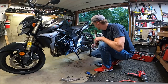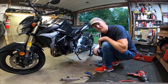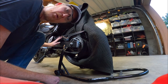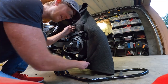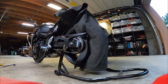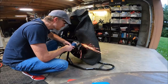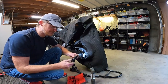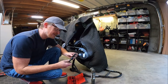If I understand, this is where I grind a pin and push the pins out to remove the chain. Once the chain's off, we can slide this sprocket off. Before I start with the grinder, I'm going to take the chain guard off so I have more space to work and don't have anything in my way. I'm going to cover the wheel with this garage blanket to protect it from sparks. Pinheads are shaved. Now we're going to take out our really cheap, junky chain rivet tool and hope it works.